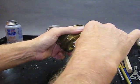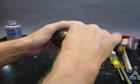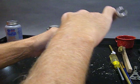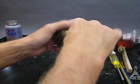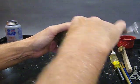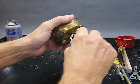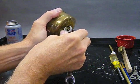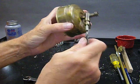Okay, so we're going to set this down in here now. Now, how tight to tighten this? Well, I tighten it nice and snug, but not so snug that the spindle won't turn. Here's what's going to happen when we start the stove up later. We'll probably have a little bit of leakage around this, and I will actually tighten it up while the stove is operating until that leakage stops. You'll see me do that.